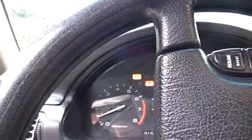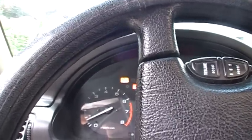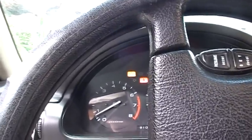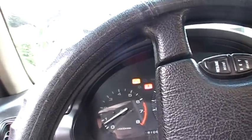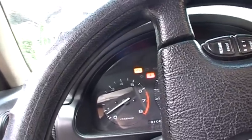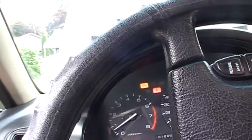And right now, because it's in service mode, the ECU, that silver box I'm showing you down there, the computer of the car, is not trying to advance the timing. So that's why this car is probably even running, unless it's so aftermarket and so off that the computer will try to negotiate the timing on its own if it's really bad. So anyway, I just want to show you that's how you could jumper that, and that seems to be working really good using those blade connectors.